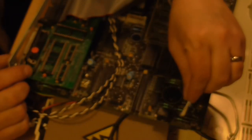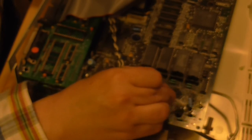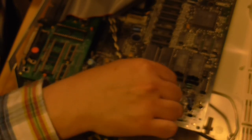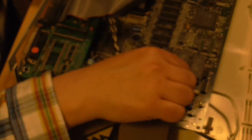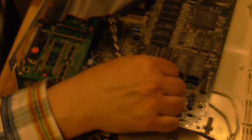That's come up quite nicely there, though I can't see because I've got my elbow in the way — I'll have to do this left-handed. I've just seen there's a little header here called alt-mouse — so a mouse connection there, alt-mouse. You could possibly wire a standard PS2 mouse, maybe? Well, I have a Smalley Mouse 2 converter on its way, so I can hopefully plug that into the Acorn mouse port and then plug a standard modern-day USB mouse in, which won't be quite the same as using the real Acorn mouse, but seeing as I don't have one of those and I don't fancy spending 30 to 50 quid on an old mouse, I'll go with the Smalley Mouse route.